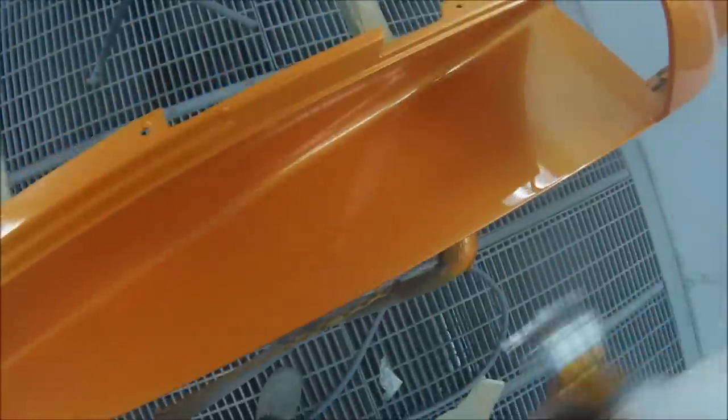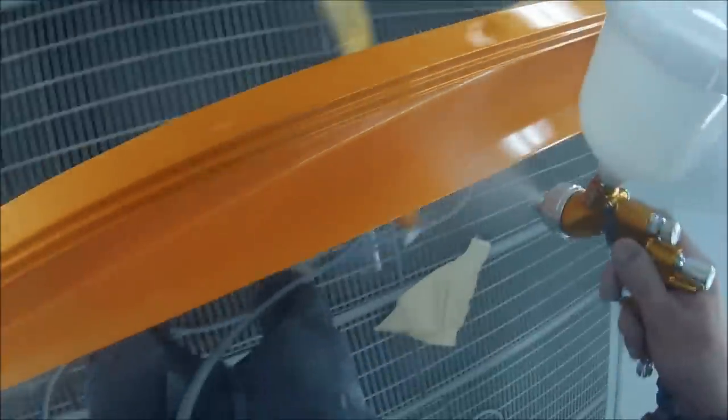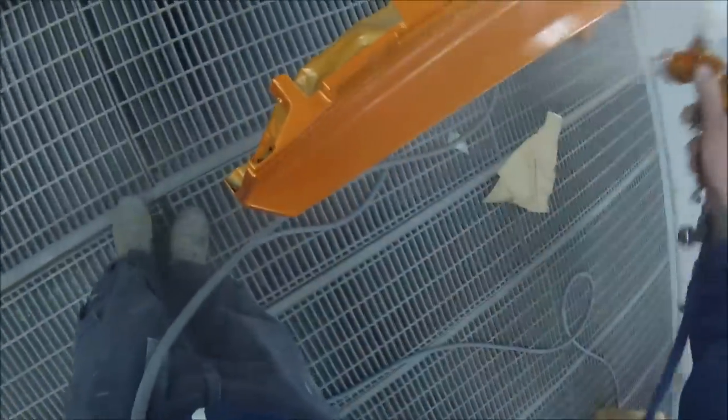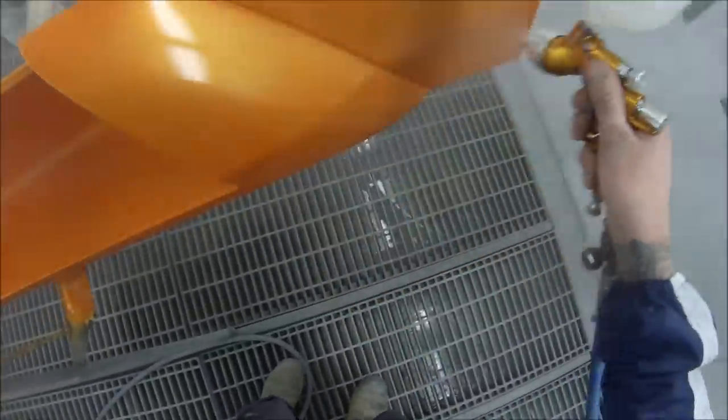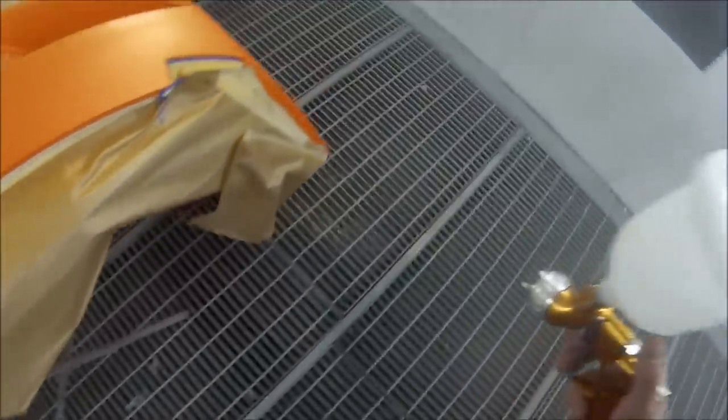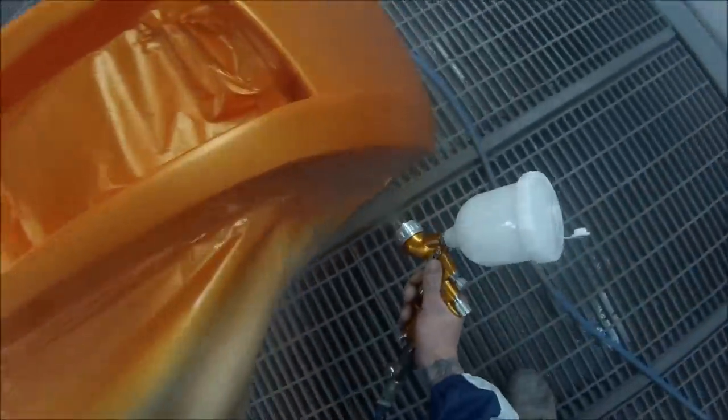Keep an eye out here — I was just doing a bit of a show off to be honest. Adjusting the fan as I go, I've just opened it right up after doing the inner as I was spraying. So now it's wide open again. Put the first coat on there and the side skirt, then come straight over and do the bumper. I'm going easy on that top edge where it edges up to the fender and also on the top edge where it edges up to the bonnet.